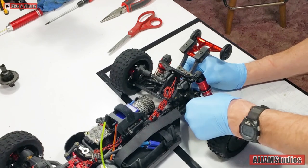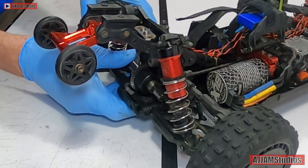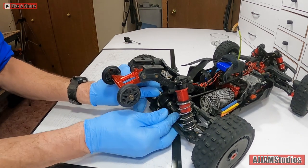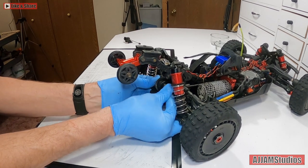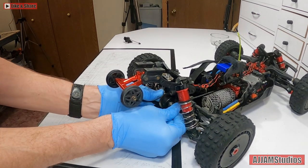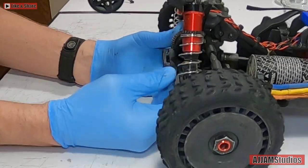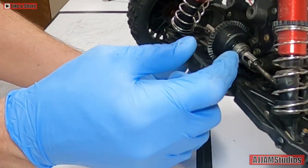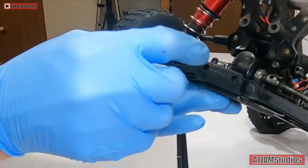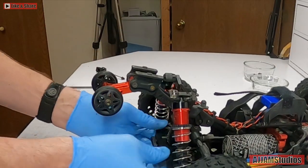Come on now - there we go, get in there. The axles will go in there. Now it's just a matter of getting things lined up so it'll go in the housing. The axles are lined up in there pretty good. Make sure there are no shim issues - this one didn't have a shim on it at all, so I don't have to fight the shim, which is nice. Once you line it up it slid right in - it took very little pressure. Now it's lined up good. Now before we can seal this up, we need to get some lithium grease on here - just regular lithium grease.